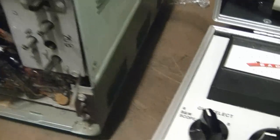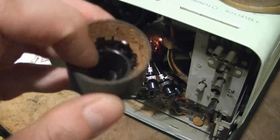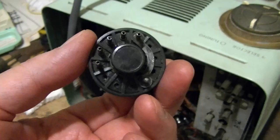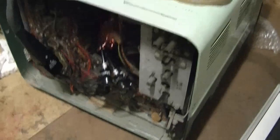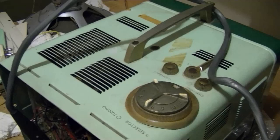I'm in the proper cut-off range, emissions are in the green — so hey! This will be perfectly usable on 6.3 volts, no question. I still don't know why they put a brightener on there. Now what's left is to perform the delicate operation of reattaching the base. As a bonus it still has this coating, so just a little bit of glue around the inside and it'll fit snugly. It'll just be a matter of threading through the 6 pins — I'm used to just doing 5. I don't know when I'll get to it, but I will someday. I hope you enjoyed this look at an Admiral 10-inch portable set from around 1957.